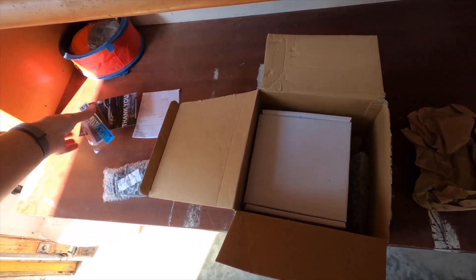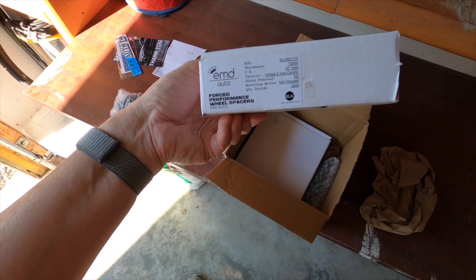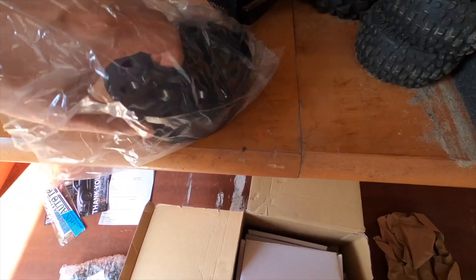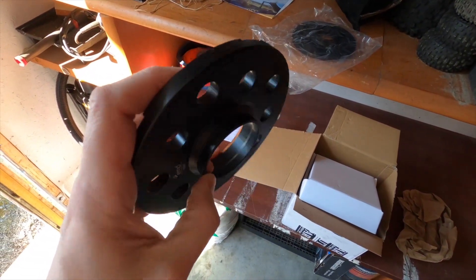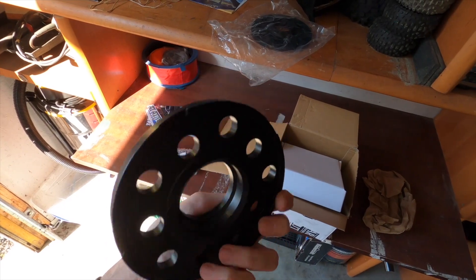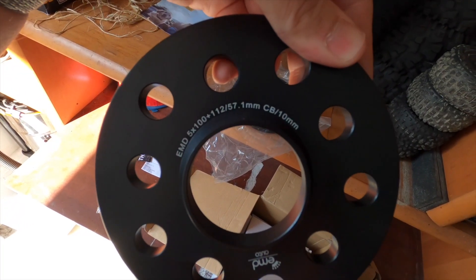It's mostly just the spacing. What I've done is found a fairly good quality kit by Emanuel Designs, EMD Auto — Forge Performance Wheel Spacers. This one is a 10 mil. Also, do not buy any wheel spacers that do not have a hub-centric ring — that is danger zone. You want to make sure you have a nice hub-centric ring so that everything stays nicely done. This one is also higher quality in my opinion because it gives you things like release grooves for prying them off.